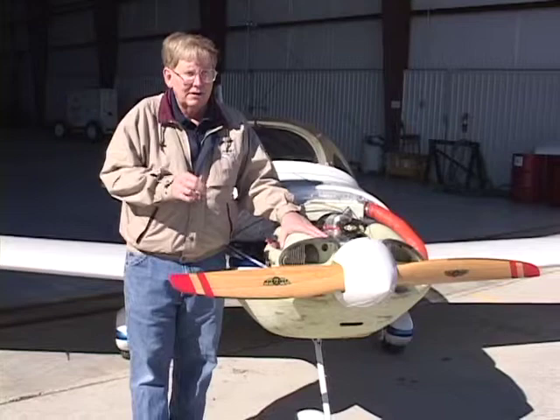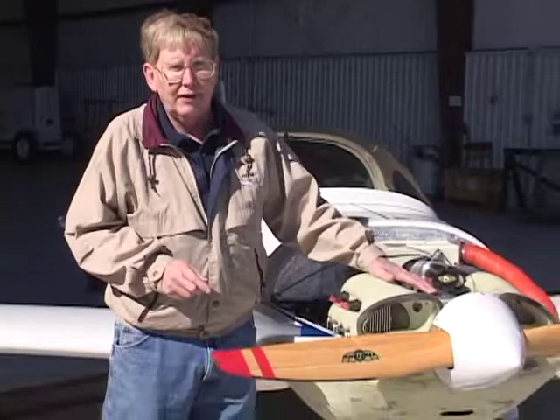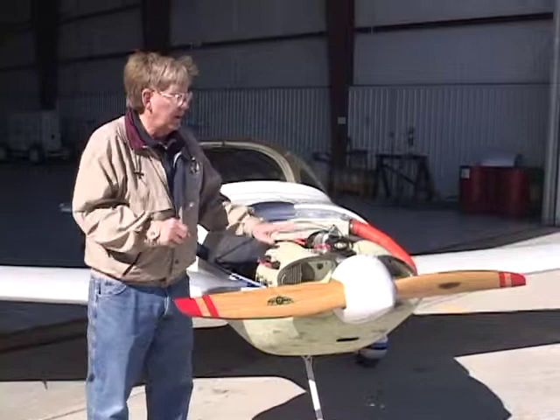The main thing about the Jabiru versus the 582 is the install weight is just about the same, so I didn't upset the balance of the aircraft by putting the Jabiru in. The one adjustment I made was moving the battery — I had a motorcycle battery mounted up front used to start the engine, and to get rid of a slight nose-heavy feeling on the stick, I moved it from the firewall to back behind the seat. Weight and balance comes out perfect, right where I want it.